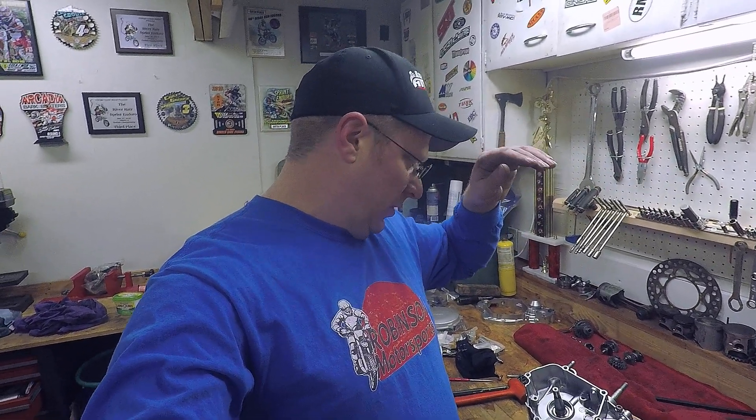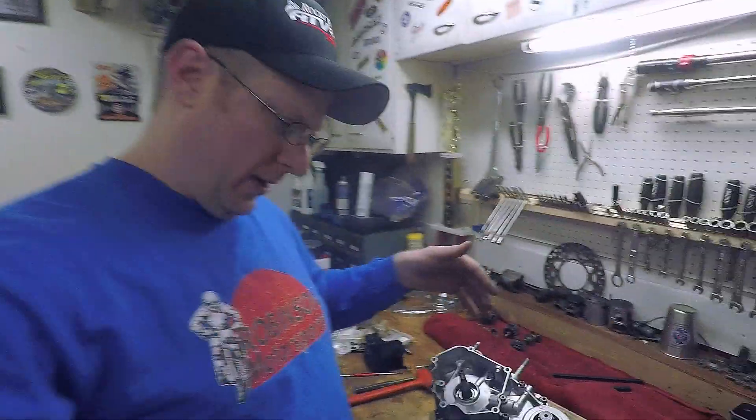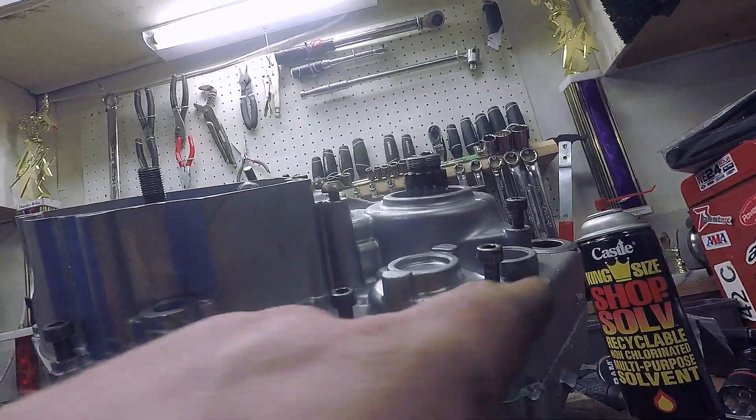The placement of all these bolts depends — you can put them in a piece of cardboard to track them, but they all have a certain length and a certain hole. It is in the manual, and you can measure them, but like I've said before, just drop them in the hole and you'll see they're all the same height. All you have to do is figure out which hole they go in, then torque them to spec in a star pattern, alternating around the best you can.